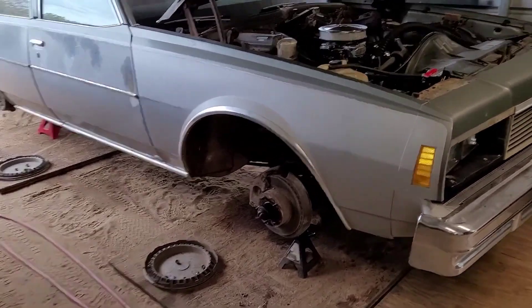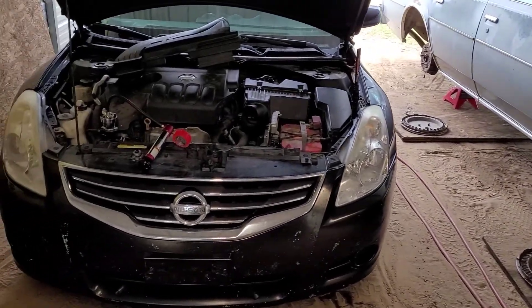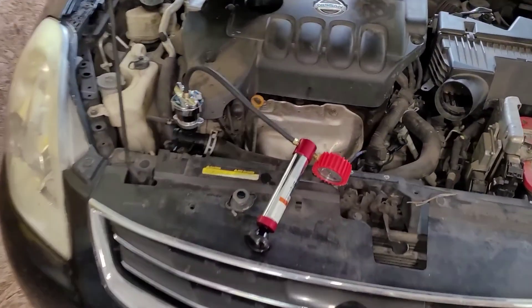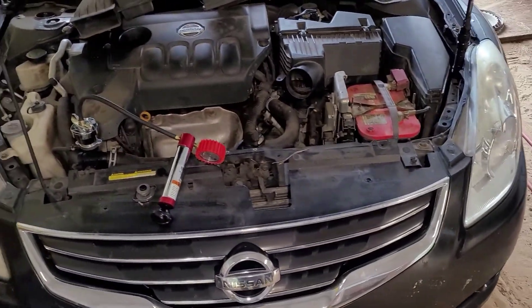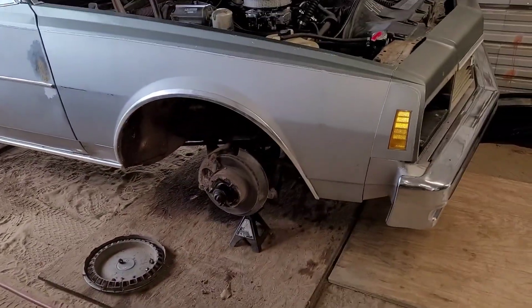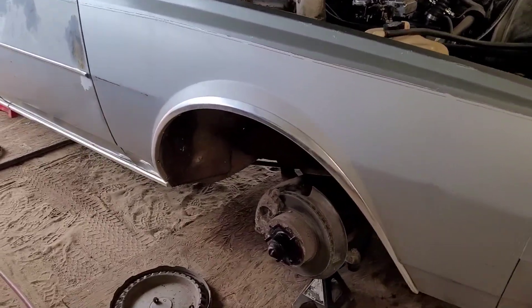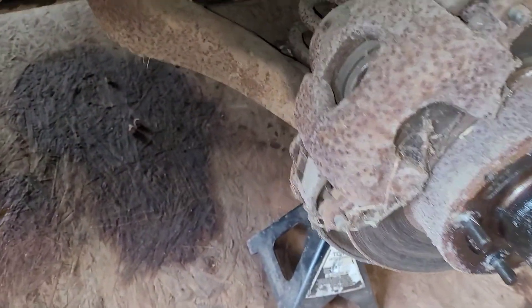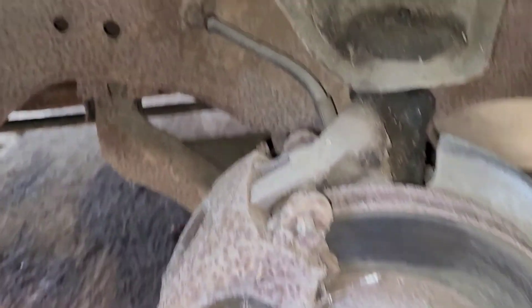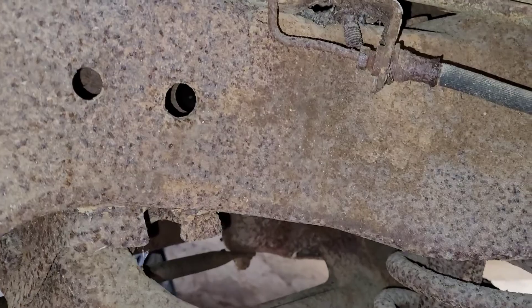There was a bit of a time delay because I got my cousin's car — I had to head pressure test it and found out the radiator is leaking. If you don't hustle doing this work, you don't have money for this. I finally got the wheels off and this is what we're looking at. It looks like it ain't been taken off in a whole lot of years. I'm going to spray all these points here, especially that back brake line — I really hope I can get that loose.